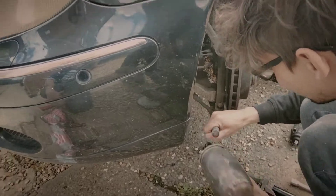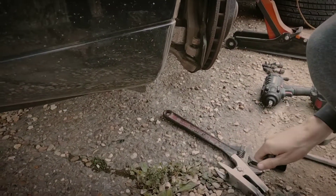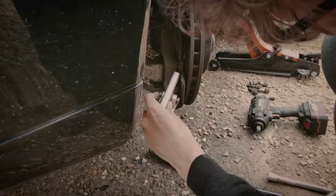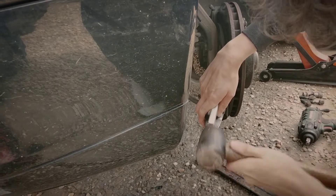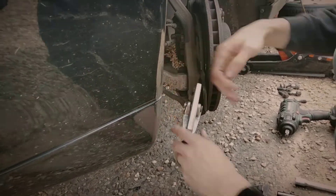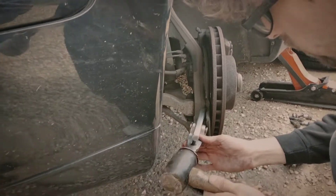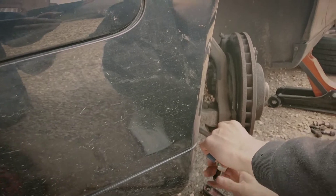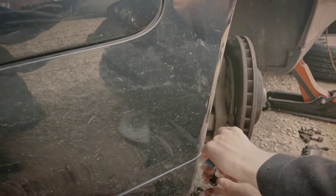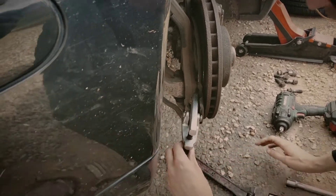The issue here is actual space to fit a fork or the ball joint splitter in. This is the part where I'm going to need a new fan because I've smashed it. It's a bit of a big ball joint. I don't know why Draper couldn't have done that the other way round, so I haven't got to go under it when it pops off.